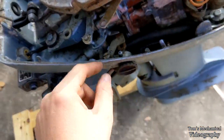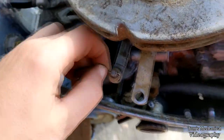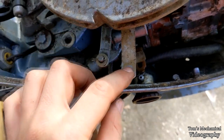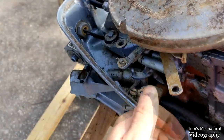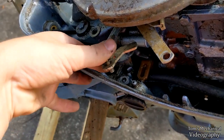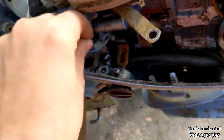Then I came over and took this arm off of the accelerator. That's just this little cotter pin up here — bend it flat, pull it back out. There's a nylon washer on top. Pull that off, then get a pair of pliers or a screwdriver in here and just pry it off the top — it's kind of tight. Next step is you've got to take this big Phillips head screw out, and that'll let you get down in there.